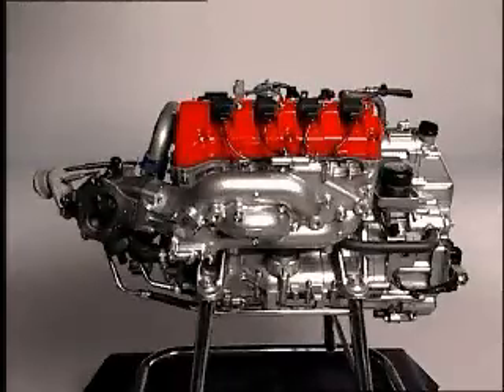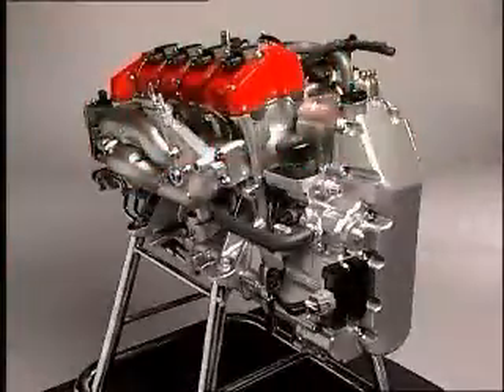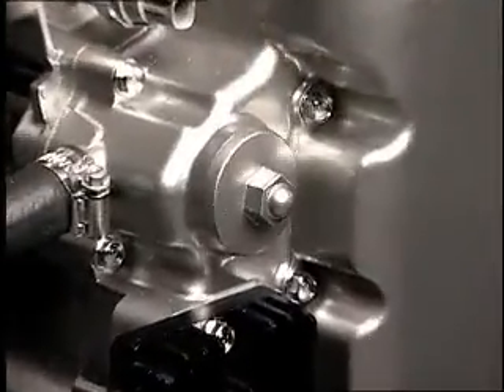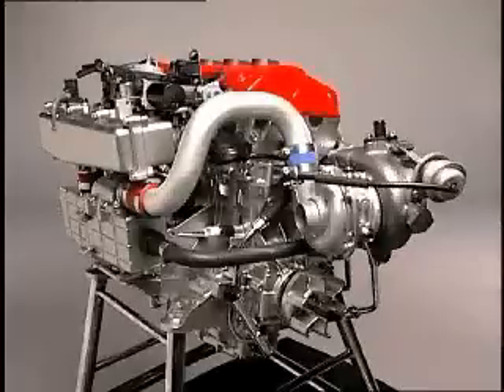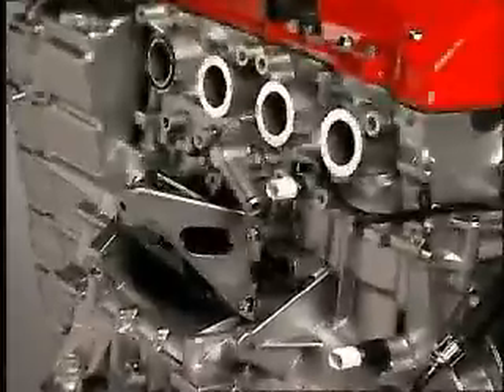Protecting the engine and body of the watercraft doesn't only involve taking care of the appearance. The key is to prolong the life of the equipment and avoid breakdowns through regular maintenance. Every time the craft is in the water, invisible corrosive forces attack the metal parts of the engine. Anodes are placed on critical parts of the watercraft to prevent expensive, inconvenient, and possibly dangerous corrosion from affecting the craft. The anodes act as magnets to attract the destructive forces of corrosion away from critical engine parts. Anodes are basically inexpensive security for the expensive parts of the watercraft's engine.